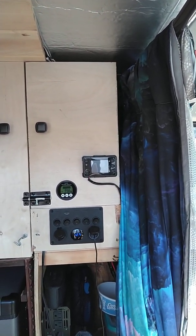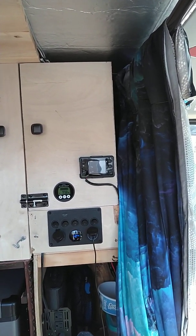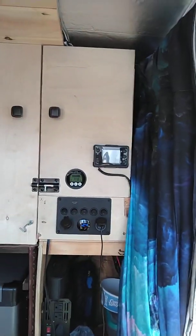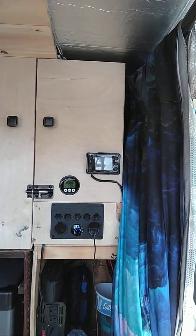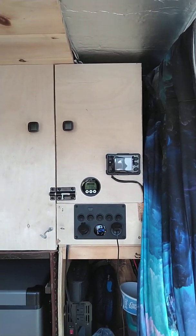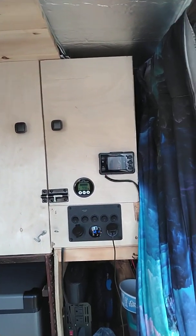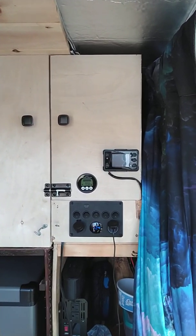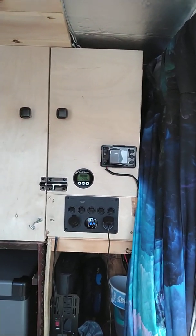So if you get a Chinese diesel heater, just know that you're gonna have to watch a couple different YouTube videos. You're either doing the OK and the down button till it comes up with the H-OF, and then you down arrow to turn it to H-ON. That primes the pump. In some cases, that is the ticket. Other cases, whatever your manual says, hopefully if it's worded better than mine was. Or in my case, I had to hit up and down arrow same time, hold it, and I actually had to hold it while it was priming the pump.